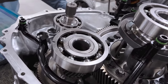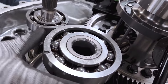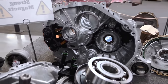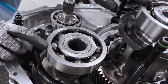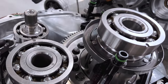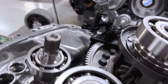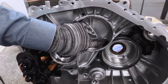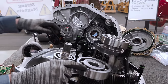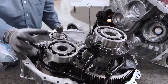I want to point out one clever thing about the way they assemble the bearings on this drive unit. When you assemble bearings into a housing, you want a nice easy slip fit so it goes together easily. The trouble is that allows the outer race of the bearing to spin after assembly, which is not good. Tesla has put a little dent on the outside of the bearing, and in the bearing pocket they've put a little spring-loaded pin. If the bearing starts to spin, it will eventually catch on that pin and never spin further — so it's both easy to assemble and the outer race is trapped and can't spin.